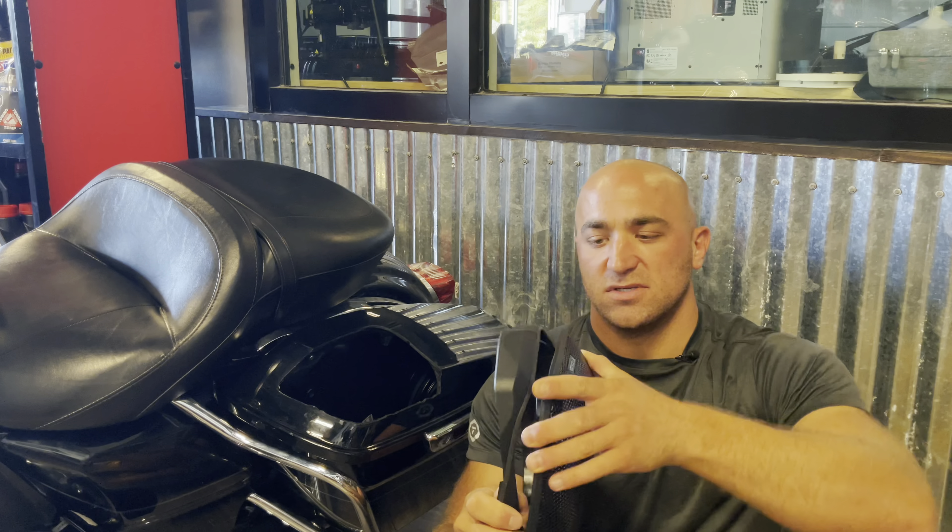What we want to do is take our grill — you can close this, line it up right here. It'll fit nice and tight in there. On this side you're going to take it, and this will actually sit just like this. The bigger rounded pumped area goes down here by the latch assembly, and you just nestle it right on in there. It's just a little tight back here, and just like that it drops in. Two smaller screws, two longer screws, and it'll pinch together and hold.